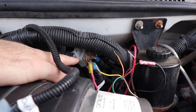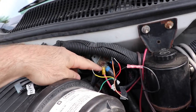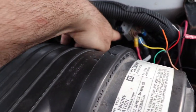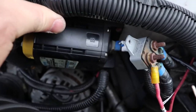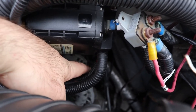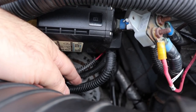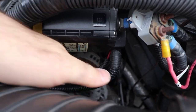There's a 50 amp relay here that you're going to retain. That goes to the back of the van to the coach, so you put that one on a terminal all by itself. I put it on the B terminal. On the A terminal you're going to have three wires: your big alternator wire, your big battery wire, and a little red wire that also goes to the alternator. That's all you need.